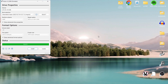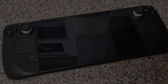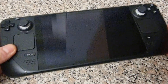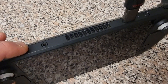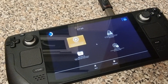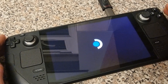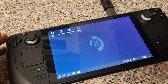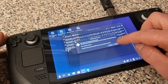Once the writing process is finished, click Close, shut down the computer, and remove the USB drive. Back at the Steam Deck, use a USB-C hub to attach the USB stick and plug it into the Steam Deck. Enter the BIOS by holding Volume Up and pressing the Power button together. Go to Boot Manager, select it, and choose your USB device. This should take you to the desktop, where you'll click Reimage Steam Deck and then press Proceed.